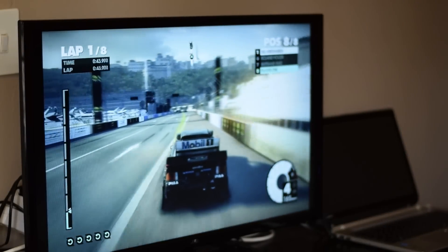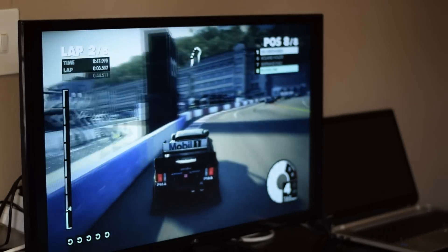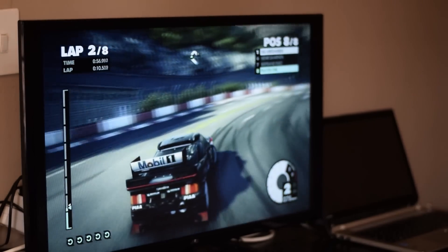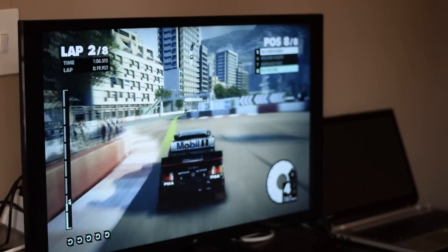A powerline network serves to send internet signal through your house's current electrical system — hence why it's called a powerline network. It uses your house's power lines to send the internet signal. For example, my modem and router are upstairs, but I do a lot of my media consumption downstairs — streaming movies, playing video games using Steam in-home streaming. I have no ethernet set up downstairs, so I'm typically relying on Wi-Fi, and if anyone turns on the microwave my connection is shot. A powerline network sends the signal through the house's power lines so I can get an ethernet signal downstairs, stream movies at 1080p, and stream video games with no lag whatsoever.